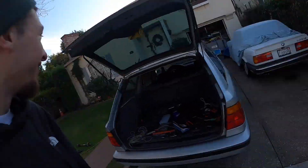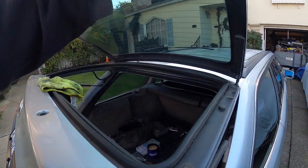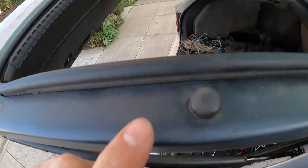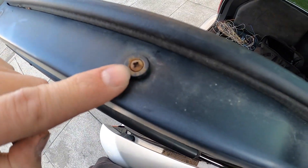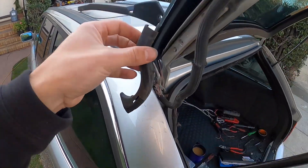If you're doing this on the E34 touring, you're going to have to open the back hatch glass. There are two clips right here — you just yank this straight up. It might be broken if somebody else was in here before. There are also two Phillips head screws that go right here. To access those, remove this little rubber bump stop and you can see the Phillips head screws. Remove this one and that one, and this entire trim piece can come off.